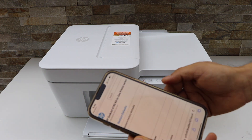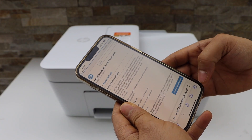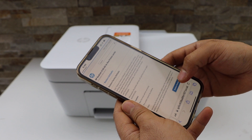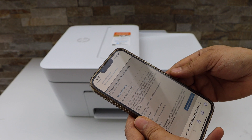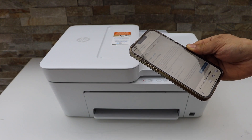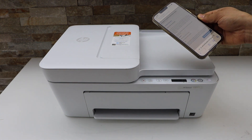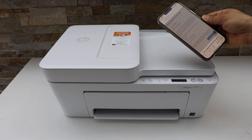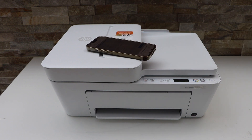Click the Submit button. On the next screen, click Restore Factory Defaults, then click Yes. It will take around a couple of minutes to restart and will be reset to factory defaults — you can see it switching off. Thanks for watching.